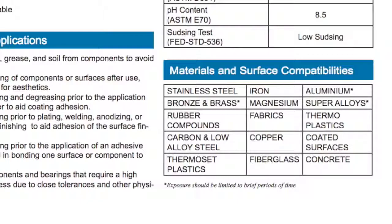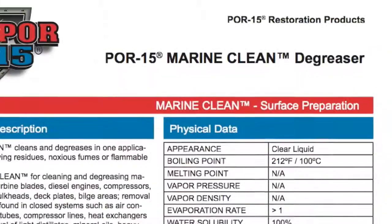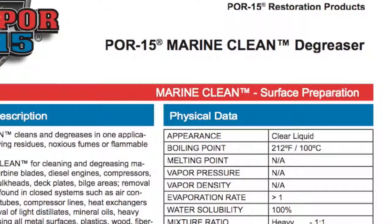So again, this is compatible with a lot of different products. Marine Clean is a degreaser and cleaner that can be used for a lot of different applications. But it's also the first step if you're using this for rust, like I did on the Mustang project, where you clean the metal really good and then rinse it off with water, then put the Metal Ready on there, rinse that off, and then you can put the POR-15 coating on. That wraps up this video and I hope this helps answer any questions you may have about Marine Clean. If you like this video, be sure to give us a like, give us a thumbs up, and we'll be making more of these videos — so be sure and subscribe to us.